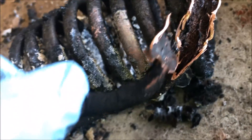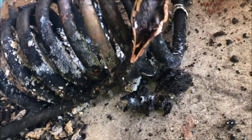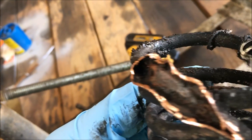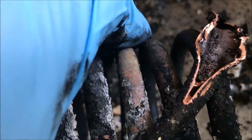Let's see if we can scrape some of this stuff. It's fairly flimsy material that you could probably wash out. I'm curious as to whether or not it would dissolve — you could probably wash it out with high-pressure solvent, maybe some acetone. In my experience, tars and varnishes are very tough stuff. They do not dissolve in gasoline very well at all — not the way you would think they would. So it's hard to say if flushing this thing out would have worked.